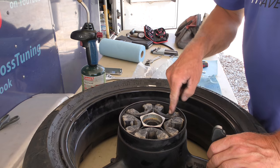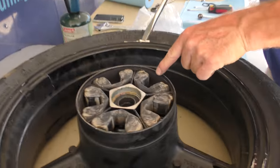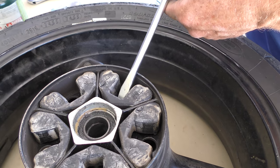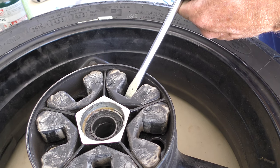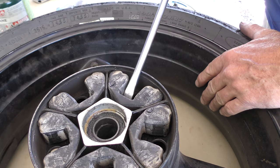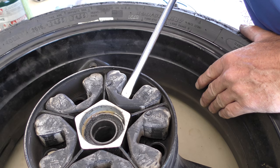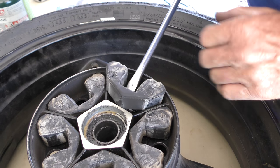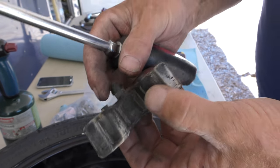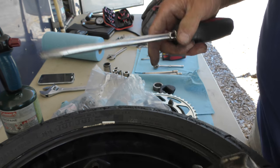Obviously, we can't warm up this surface or the bearing surface. And what you can't do is mar the inside here. So it will go underneath and you can see the float we have, and you've got to ever so gently tease and see if you can lift it and make it stretch and then pop, and then make sure all of it's there. So there's also two little locating rubber dowel pieces there as well.